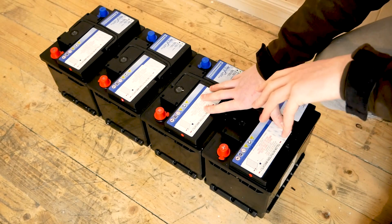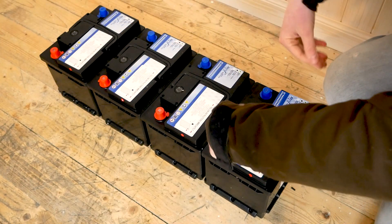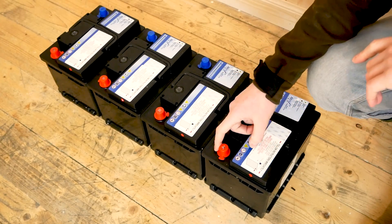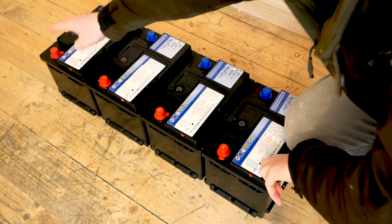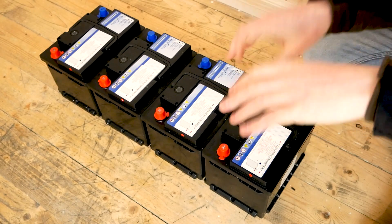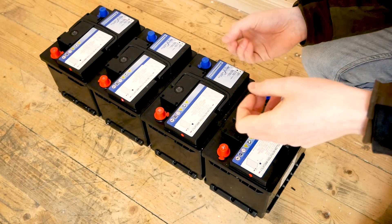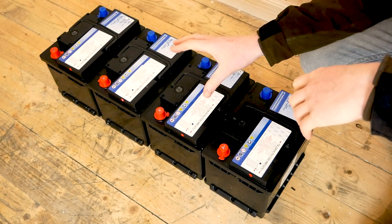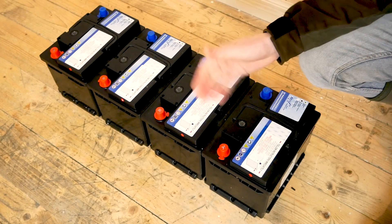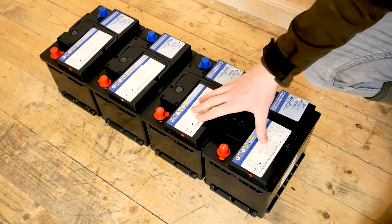The system in the Buffy is a 12 volt system, so we need to keep the system at 12 volt but add these extra batteries in. When we build our battery bank, we're going to be wiring it in parallel, meaning each battery is parallel to the last one - connecting positive to positive to positive, and the same with the negative. This keeps the voltage the same; when you wire things in parallel, the voltage stays the same but the amperage increases. So the amp hours of these batteries as a bank increases from the 60 we had originally up to 180, while maintaining those 12 volts.